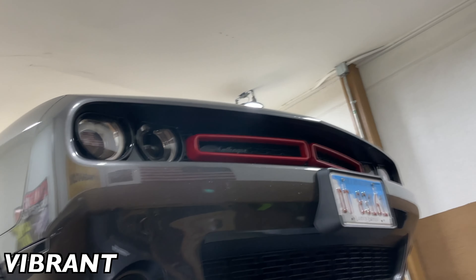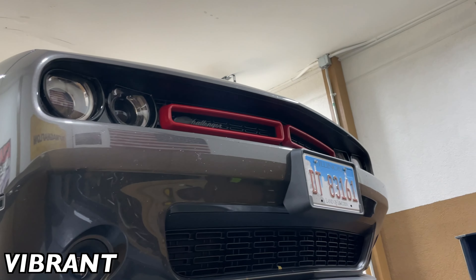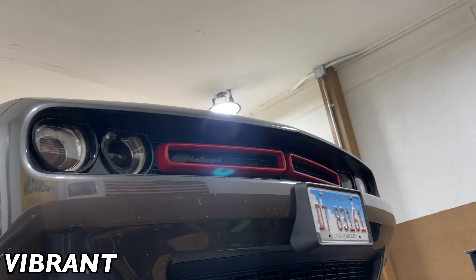2022 Dodge Challenger V6, got the nice red inlay in it. They drove from Illinois, came vacationing in the Smokies, and on their way back said they had to hit Exhaust Attics. We really appreciate them bringing it by. What we got done on it for them: factory converter, only got three thousand miles on it, factory X-pipe, it's two and a half inch pipe.